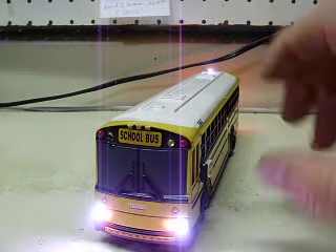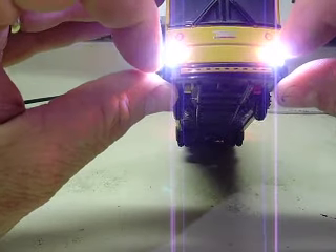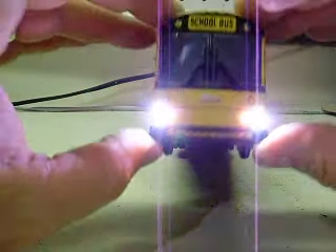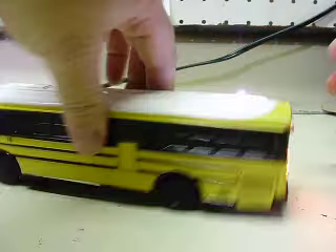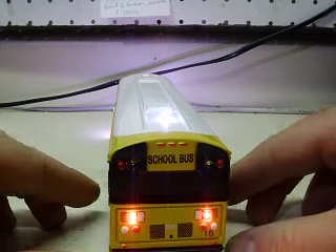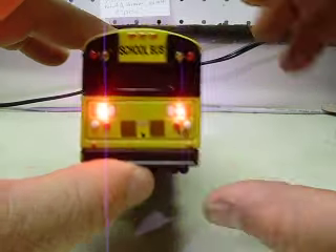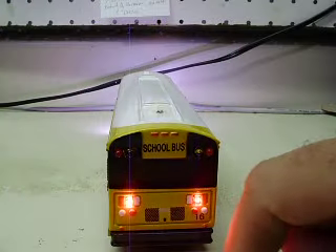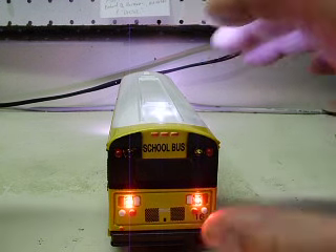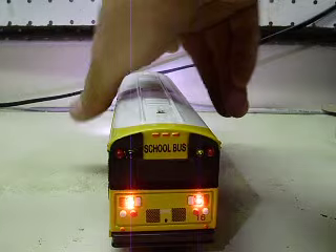As for the headlights, we use hyper white since some of these are newer style buses. You can also see the amber parking lights — they show up a lot better in person. Spin it around and you can see your rooftop strobe and then steady taillights. Since these have rectangular taillights, I don't just drill a hole and pop an LED through there — I actually file those out so they are rectangular, hand filed for the LED to fit in there. They look round here because of the way the camera picks up an LED, but they are actually rectangular.